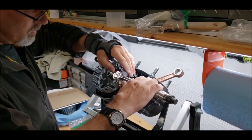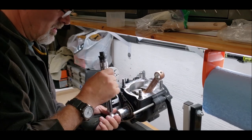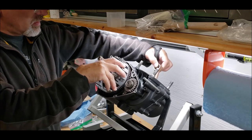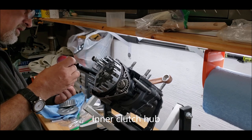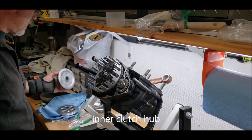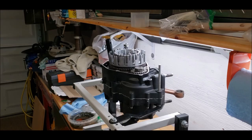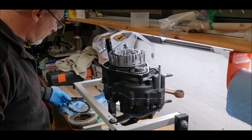Now we'll do the seal for the shifting arm. This bike I've used more OEM parts on it than any other build because you just can't get aftermarket parts for this bike at all. Get the shift shaft back into position — hopefully it goes right into the seal, and there we go. Moving back to installing the clutch — using regular oil here. Put a little bit of engine assembly lube on the sprocket. It was a real tight fit but we are on — and clearance for the sprocket looks good; it's not touching the idler sprocket.